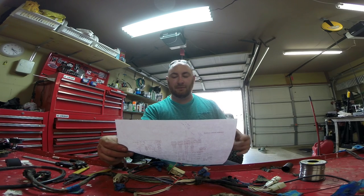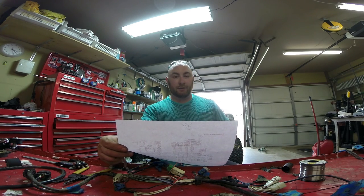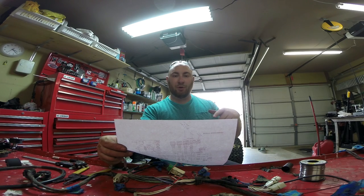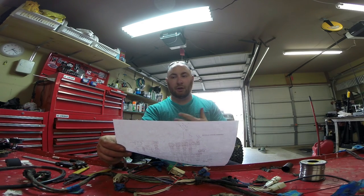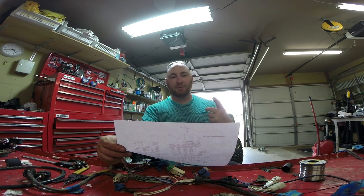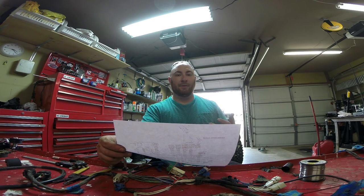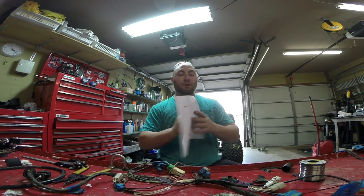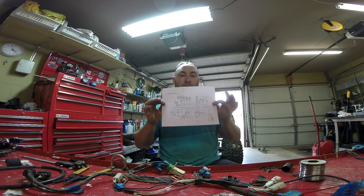That's not acceptable for us, so I'm going to extend those wires all the way back. I also ordered a simple hydraulic switch that basically screws into the brake caliper or the master cylinder, replacing the banjo bolt — when it senses pressure it opens or closes the connection. We'll run 12 volts to that and have brake lights. I only realized this was missing when I started looking at the diagram. These wiring diagrams are your friend — they will save your life. Learn to read them and it will make life a hell of a lot easier.